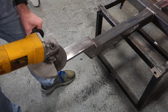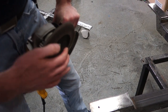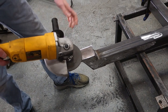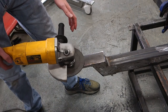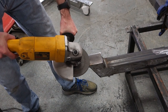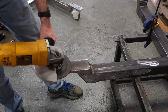And it's lots of movement. You want to pay attention to the angle that I'm at. Because you don't want to hit the centerpiece. You want to be working down in here. You don't want to work the edge. You want to be in this area, so you're going to be on an angle about there, okay? But anywhere as low as that or as high as that is okay, just to work it out. You want relatively slow. If you're focused on a small spot, you move kind of quick because you don't want to burn it. If you're getting things where it turns blue, you're too long in one spot. So about like this.